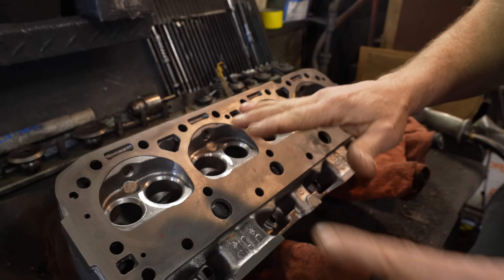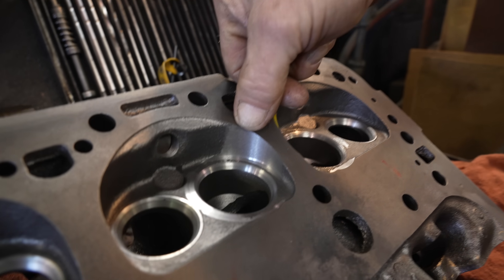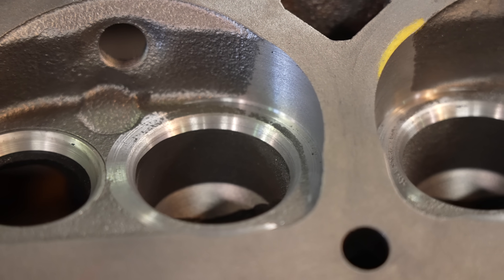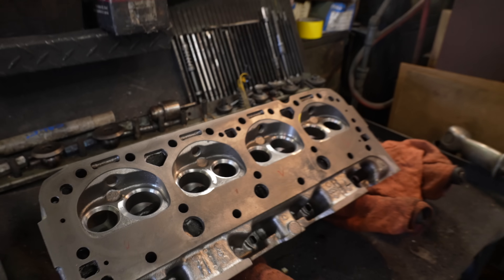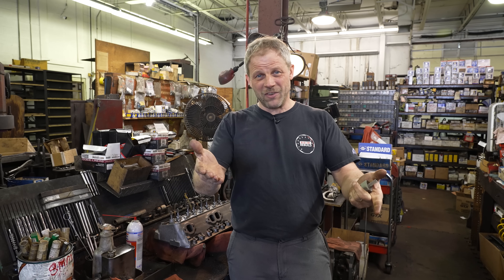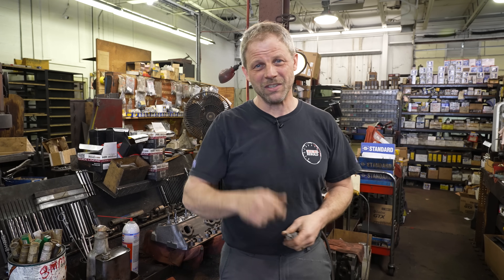We have our seats completely done. One of the things we did is we went in and cut a little relief here on the sidewall — cut this back so when the valve comes up it's got a little more clearance to the outside edge. That'll let the intake valve flow a little better. We did that on all eight of the intake valves, so those chambers are cut back a little bit. That's going to wrap it up here for today — hopefully you enjoyed all that. Click and subscribe if you haven't, and turn notifications on, because you don't want to miss out on something interesting. Get out in the shop, get your work done, and find a good machine shop to take your stuff to.